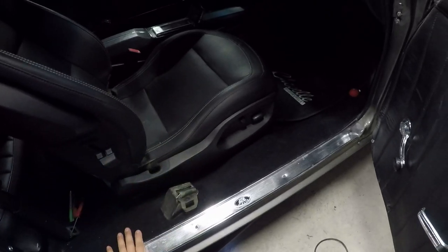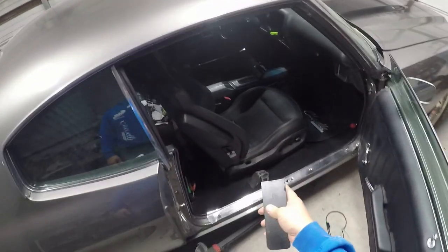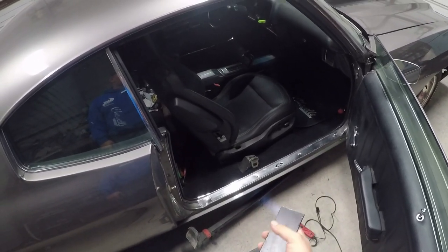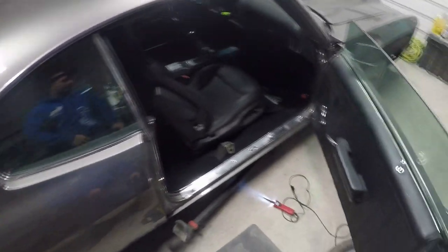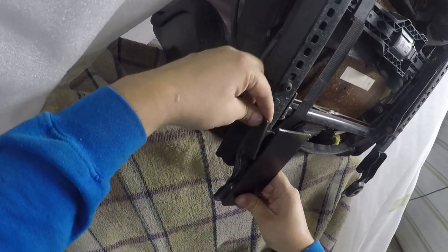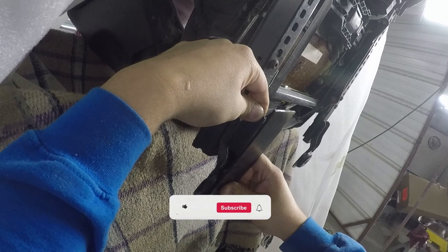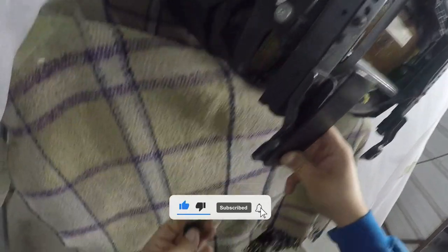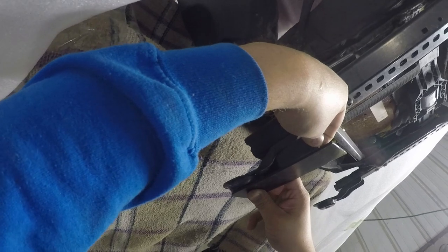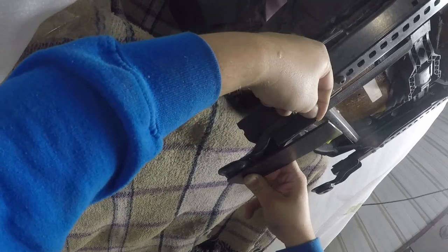This is the passenger seat — it's installed, and this is how it looks. There's another video on how to wire up the seats, telling you which wires to tap into so that your controls work. Coming back to the bracket, we're gonna have this bracket here and then we need to fill this gap. So you're actually gonna have to make this small fill piece a little shorter than I said — not two and a quarter, actually about an inch and a half long by one inch.